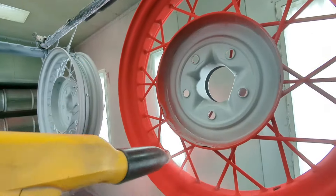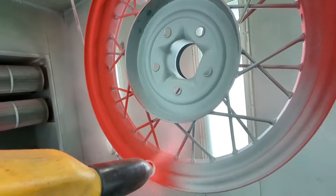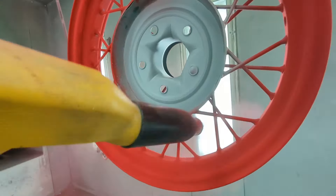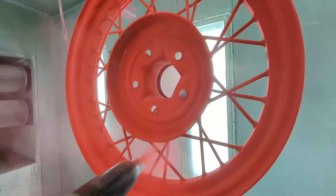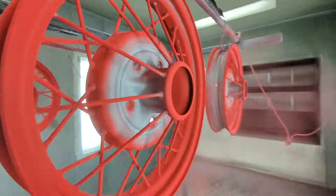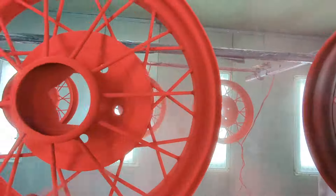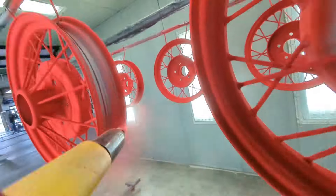Certain colors don't look good when it's only one coat, unless you can put one big heavy coat onto them, but there's a lot of risk involved in that. You get framing or edge building. You could even get a sag or a run, depending on the type of color. We're doing the two-coat process, where you put some on, flow it out just a little bit, pull it out, let it cool, and then spray another coat on. That tends to not have any of those problems associated with it.